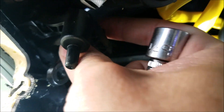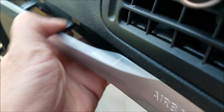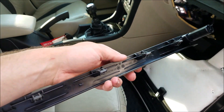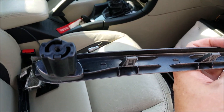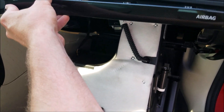Don't be alarmed if this moves — it is just part of the mechanism and will not come out with the glove box trim when you pull it. It pops off like such — it's a little bit easier with the trim removal tool but it's not required. There are one, two, three, four of these clips, and then that Torx screw. Once you remove this, reassembly is just in reverse order. You get to put the new one in — reverse order, super simple.